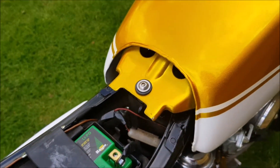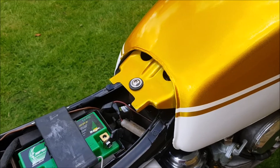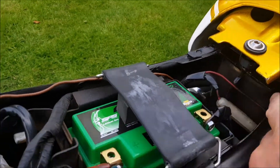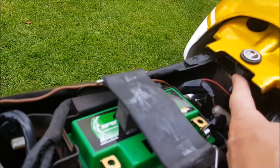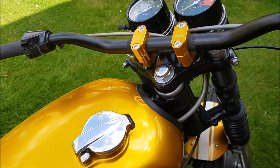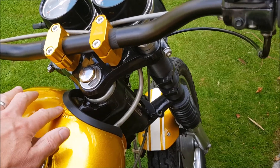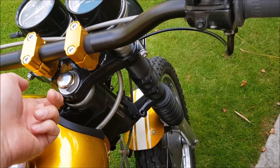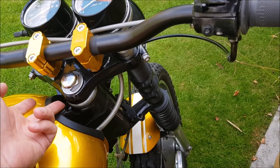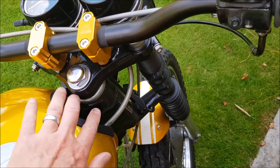Part of the modification was to flatten out the tank, because the tank's on a bit of a rakish angle on the CL350 — it looks terrible. To get it looking good I've made a spacer under here, so the tank is screwed down. There's a rubber there just to stop the vibration. If you ever take the tank off, take that screw out and don't lose the spacer. Being a perfectionist, I've spent a lot of hours on this bike. The only thing that's not perfect is this little bit of paint lift here — it just got damaged. I think the previous paint had been damaged. When you take the tank off you've got to be very careful when you shunt it forward that you don't crash into the top yoke — that's kind of what happened. I'm going to put a rubber around here to protect that so it won't happen again.